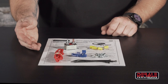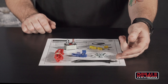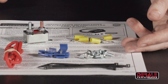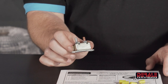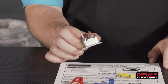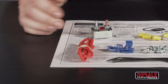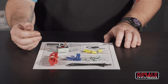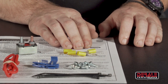Looking at the kit contents of what comes with this controller: there are basics like zip ties to keep the wires clean and out of the way. We have some sheet metal screws to hold the controller and the circuit breaker in place at your desired location. There's the circuit breaker itself, which is a 50-amp breaker rated for all Derale fan kits. We have some number 10 red wire to make the connection from the breaker to your battery or power distribution point. Some scotch lock connectors in case you don't want to cut wires apart, and ring terminals to make those final connections.